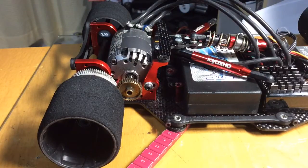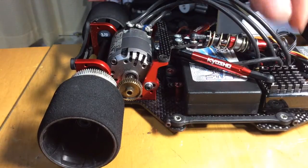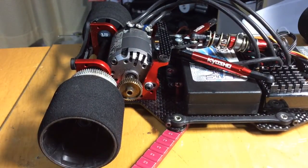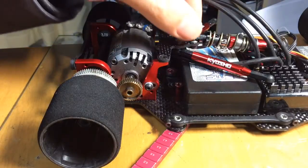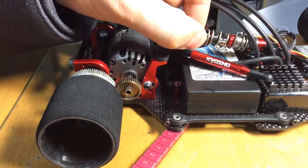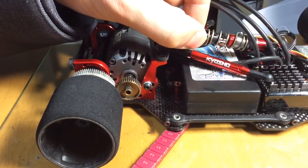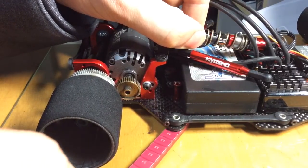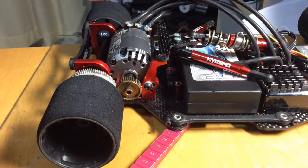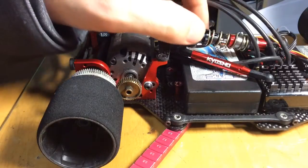All right, so first you measure the point here. So let's just go 1, 2, 3. Measure that, 3.8 millimeters. Now, just simply raise up the pod here, where the shock mounts here, and slide the gauge underneath. So 3.8 all the way to, we'll say 4.8, so 1 millimeter's worth of droop. That's okay, it's not bad, but let's try to increase it.